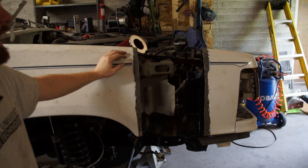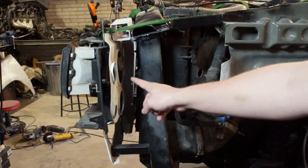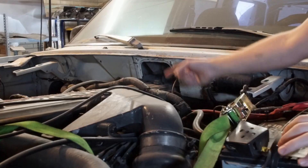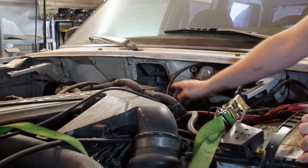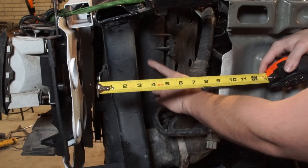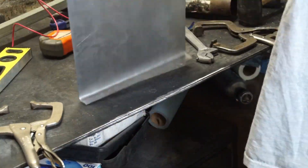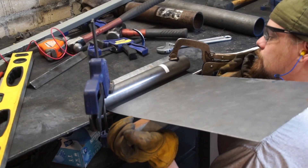Well, I cut it, and now this is the gap I need to fill with sheet metal — it's basically 11 inches. When I talk about needing to fill an 11-inch gap, it's not that the entire engine is sitting 11 inches further than stock. When I built this, I put the engine as far back as I could, even cutting the cowl a little to force it further back. The biggest factor contributing to that large 11-inch number is that I now have a very thick radiator and an even thicker intercooler in here. I thought it was worth giving up a little approach angle and doing more work in order to guarantee enough cooling and more power with the intercooler. Every decision is always a tradeoff when building a project car, and I hope it makes sense why I thought this tradeoff was worth it.